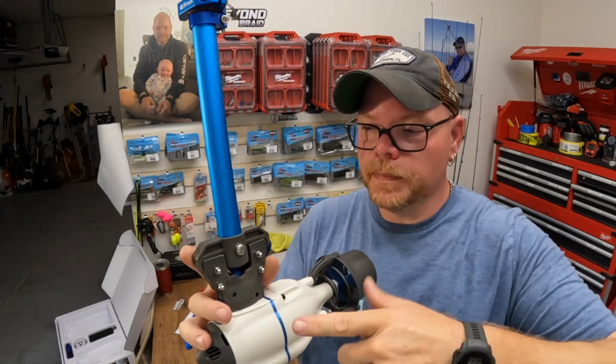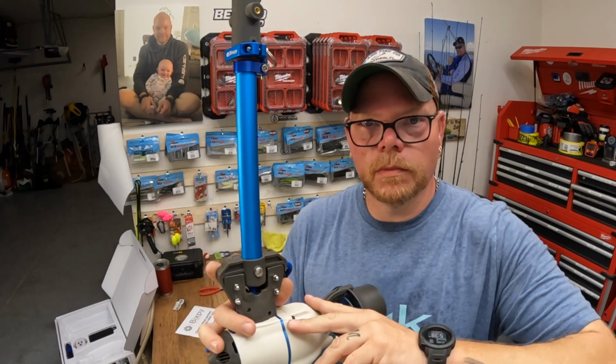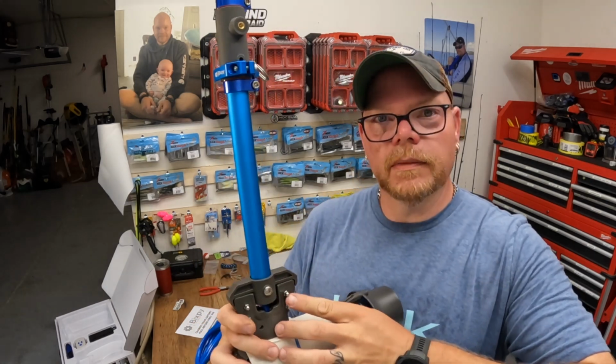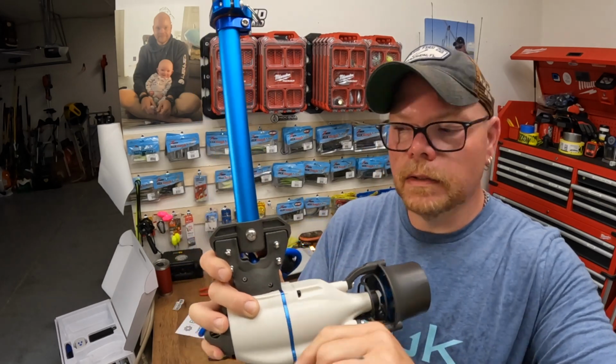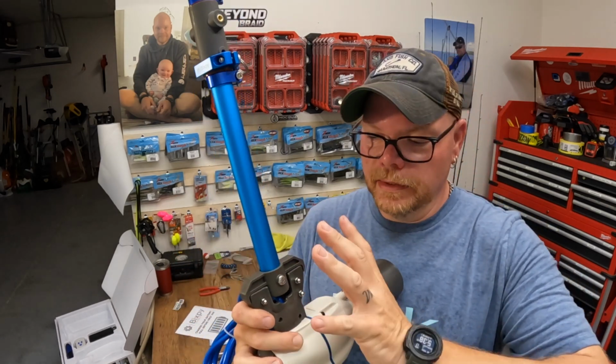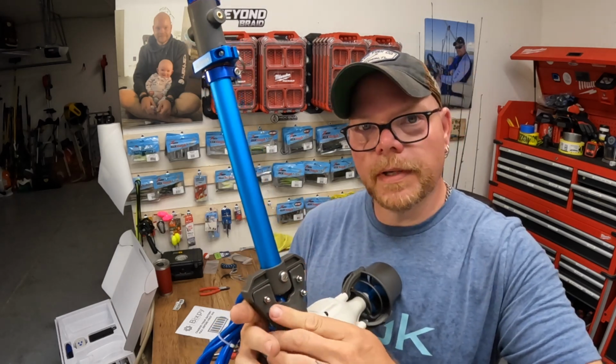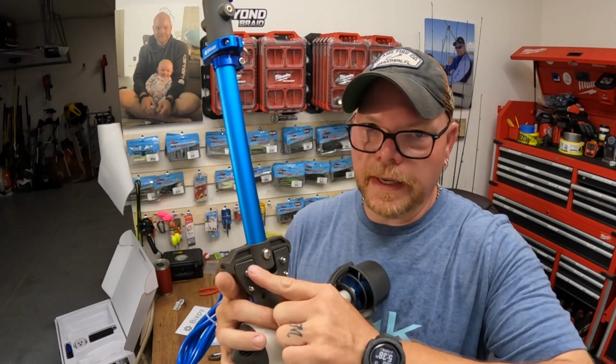Now if you're listening, Bixpy, anything that has vibration, which you guys should know, anything that vibrates comes loose. Me personally, what I would have sent with this is stainless steel nylon nuts for this that just prevent any backing off. I don't know if you guys had any problems with these yet, but that's just my personal opinion that I would use nylon nuts here instead of just the cap nuts.